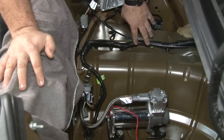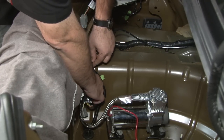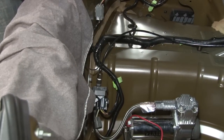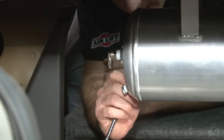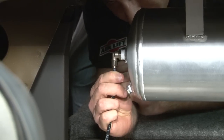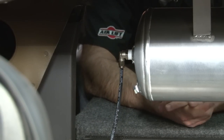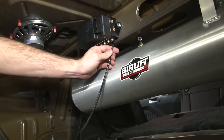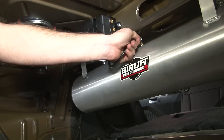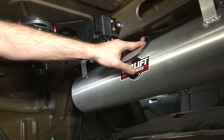We've tied the airline to the factory harness here to run up to the tank. I'm connecting it to the compressor pump and then to the tank itself. The opposite end of the line from the compressor hooks right into the tank — that way when the compressor is running, air comes right into the tank giving you a reserve so you've got air on demand whenever you need it. Now we're connecting the manifold to the tank supply line, plugging into the pressure connection on top, and now we have air pressure to the whole system.